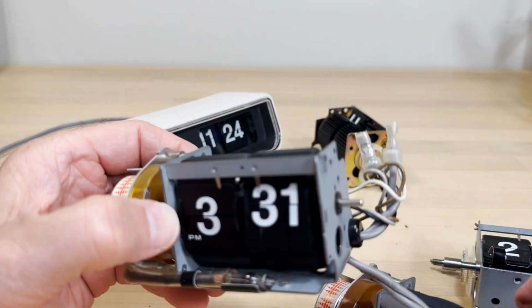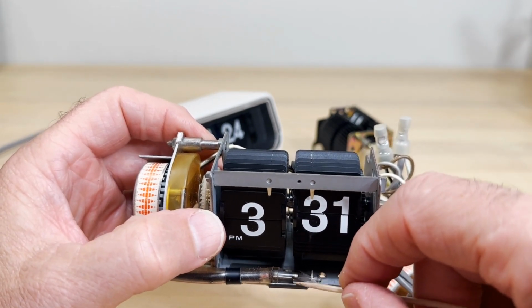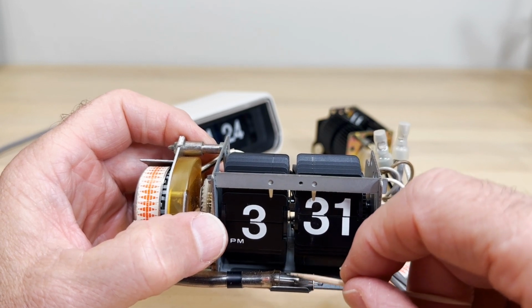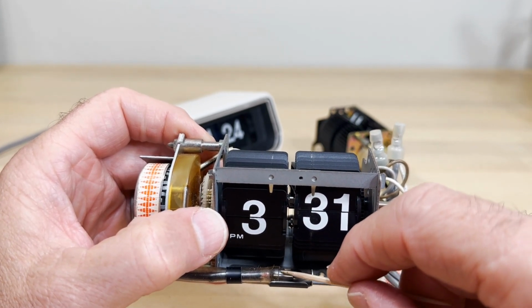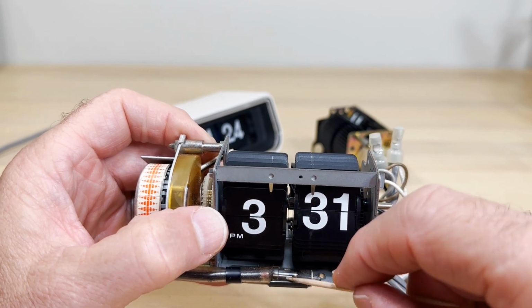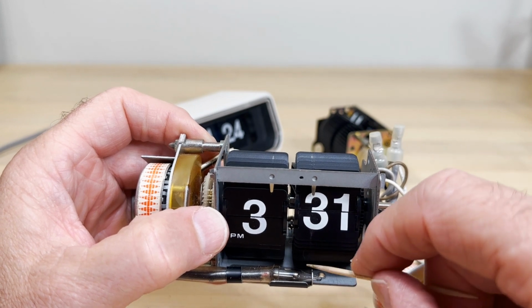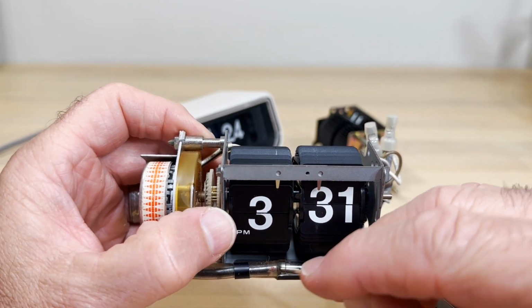So where do you get those bulbs? Well, these use the neon glow bulbs. A good one is called the indicator. It may be called a NE2, NEH2. These I get online, and they're indicated C2A. So C2A is a really good replacement. Just go online, Google up C2A. I'll try to include some sites that actually have these and where I would get them.